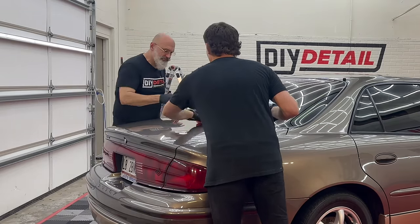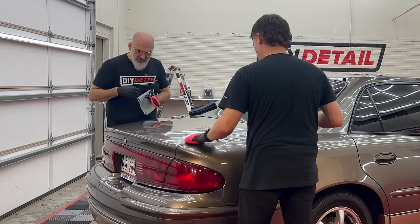There's no pressure at the end of your stroke when you're doing circles — it's just a nice, even circular motion. The circular motion also, counterintuitively, uses less product because you can spread it thinner. The crosshatching pattern uses more coating, and there's no reason to use more. As long as you have coating deposited on the paint, that's all you need. A thick layer of coating is not better — all you're doing is taking more off with your leveling towel. If your leveling towel is getting wet, that's a red flag — it should never get wet. You should be able to do a whole car with one leveling towel and it'd still be dry at the end.